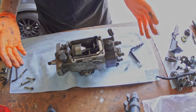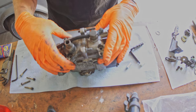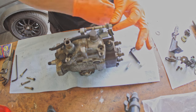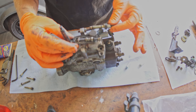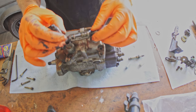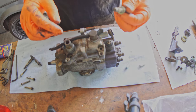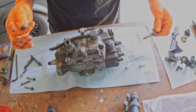So basically how these pumps work is, let's put this lid on for a minute to help our imaginations. You have your overall fueling set screw, which goes in right here, and then you have your throttle applicator, which goes in right there. So when you're hitting the gas, you're actually moving this linkage like that, and it's pulling on this end. And when you adjust your fuel screw, you are changing how far in this tip pushes.